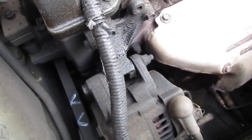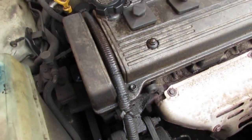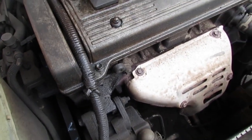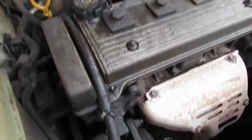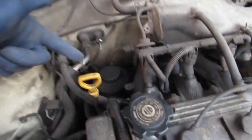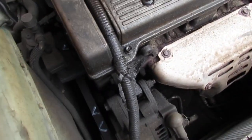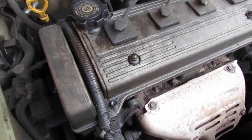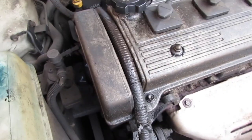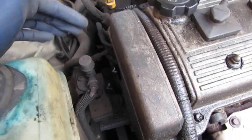So what happens when you turn the steering wheel? The first thing I asked was, is it difficult to turn? The reason I asked that is because it would indicate that the hydraulic system itself is not functional, that it's leaking. The answer is no. So immediately I know it's not the power steering fluid leaking out of the system that's causing the squeaking sound when the client turns. What I did notice was when you turn, you'll see it idles, but you hear the sound go up. The reason is that more pressure is needed when you have a power steering pump functioning to turn a wheel.